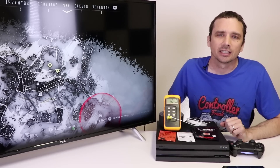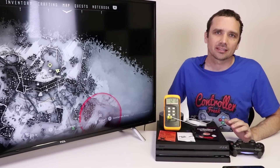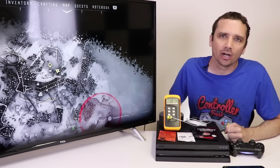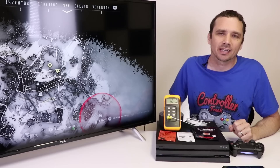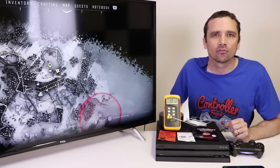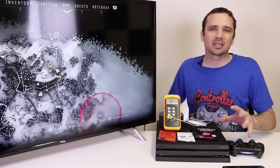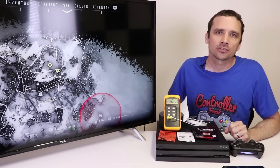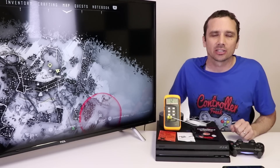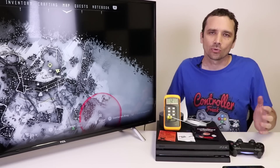I also noticed the fan did get somewhat loud — it didn't get as loud as I've heard it, but it still did get loud. So this particular thermal compound doesn't necessarily keep the fan super quiet all the time, but it does seem to keep it quieter and it obviously keeps the temperature lower on the PS4 Pro. Based on this one test, it does seem that the Thermal Grizzly Conductonaut works very well for the PS4 Pro on intense games using 4K and HDR, so I can recommend it to keep your game console cooler. Please keep in mind this is just based on one small test for about an hour or so, so you may see different results over longer periods of time. Theoretically, the liquid metal will stay liquid and will never dry out on your game console and should last the life of the console fairly easily, but I haven't actually tested it for very long, so I can't say for sure.